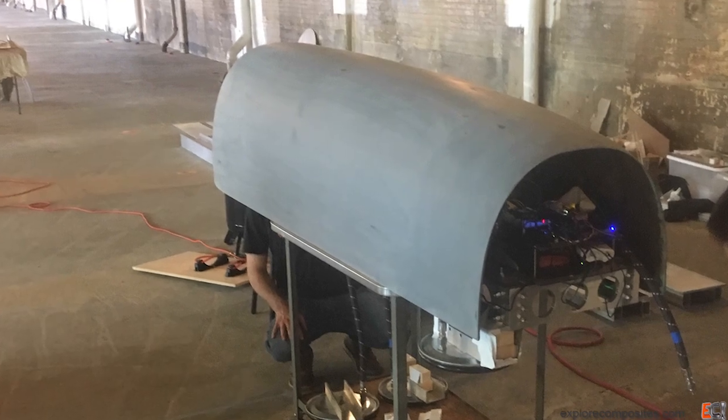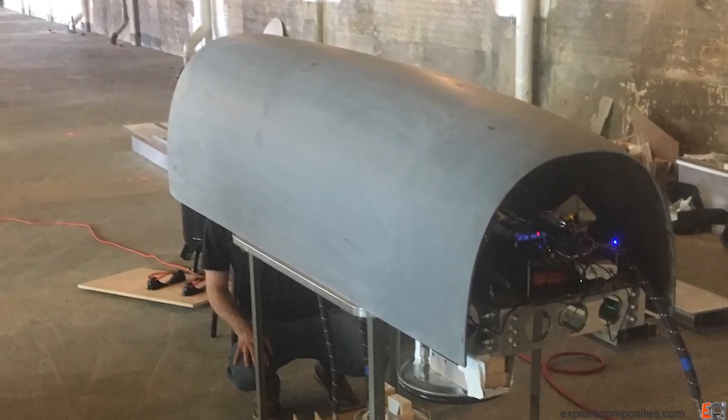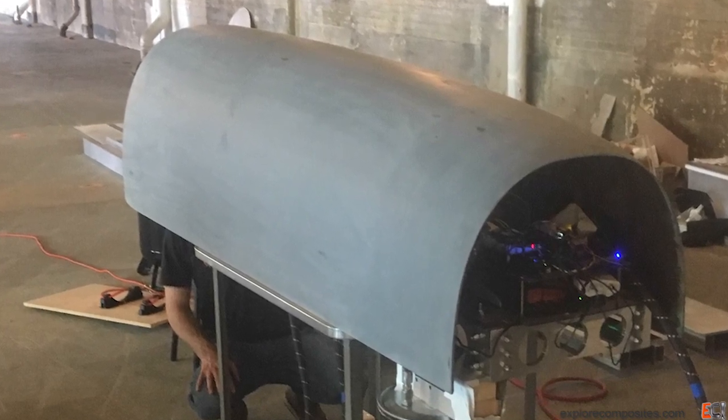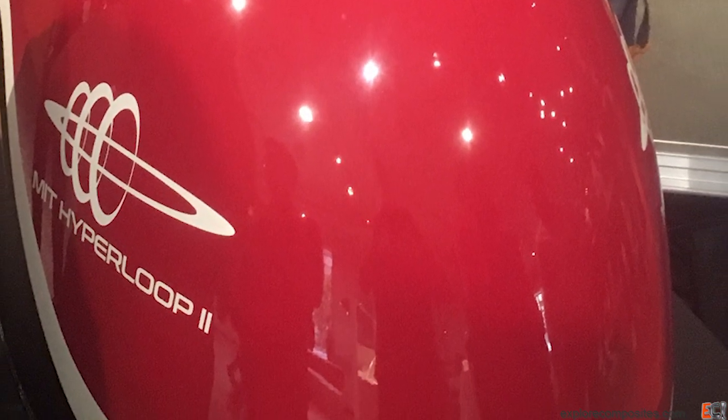The foam bridge — I had to go back and do a bunch of filling. This again is a consequence of doing it all in one shot. But with a couple of rounds of 545 primer, it started to look pretty nice. We took it down and tested it on the vehicle frame — everything fit pretty well. And we're in a big hurry to get it to the paint shop, where they did some final priming, blocked it all out, and did an incredible job with the paint and graphics.